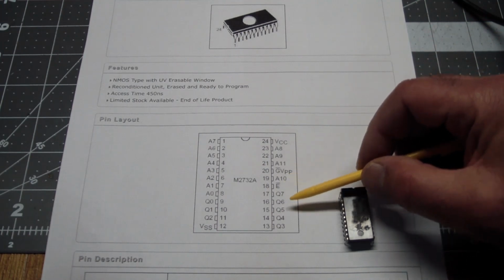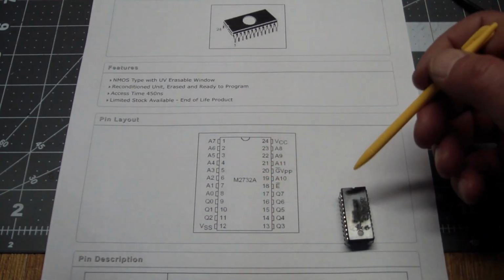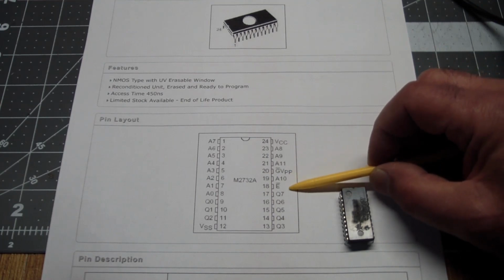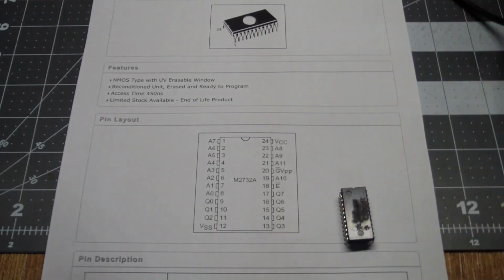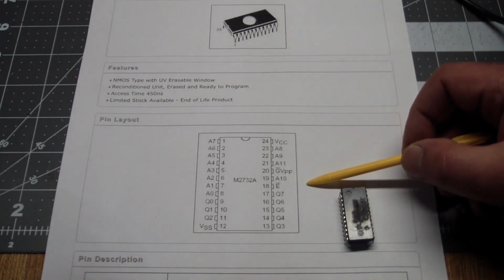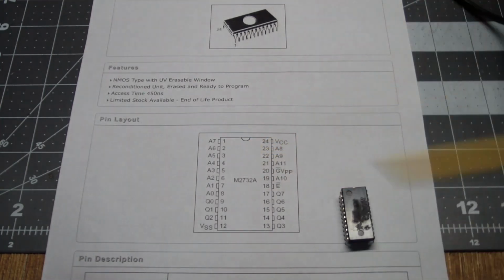And after looking at it, the way this whole thing works is address line A12 was used as a selector because of the limited address space in there. When A12 is high, the machine's trying to read a ROM. So all we had to do was invert that. So when A12 goes high, it puts a low in here and enables the ROM, actually enables the Eprom, and now we can actually burn images into Eproms and play them.